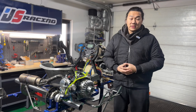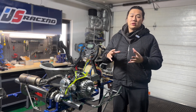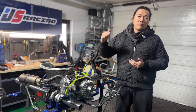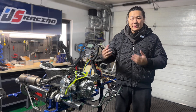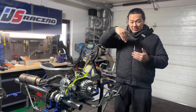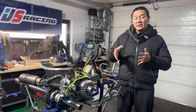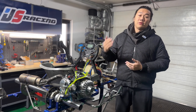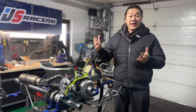The three-angle valve job is a bit like porting for the valve seats — porting is essentially cleaning out all the imperfections and jagged edges. Like an aerodynamic visualization with smoke going through an aerofoil, any kink causes vortices around the imperfections. By removing those, you allow air to travel smoother. The valve seat right now is closer to a 90-degree angle; by making it into a more trumpet shape — that's basically what a three-angle valve job does — we enlarge it a little and make the angle a lot smoother so air can travel easier through the intake and exhaust ports.